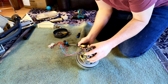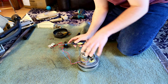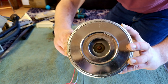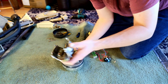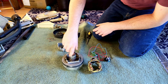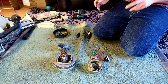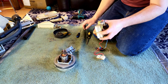With everything dusted off — this is a very good motor — we can come over to the side clips and pop those off. This is the same for all of the Electrolux motors of this era, whether you have a belt spindle coming out of the top or not. In the UK they riveted the fans on so you can't do anything about that, but you can take the top off. There are the carbon brushes. You can then take the coil off, and that's it — this is as far as you can go. This one spins the best, though still not brilliantly. I might leave its bearing — I've been spraying oil into the others because they've been really bad, but this one has a very nice wind-down sound.